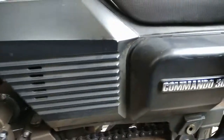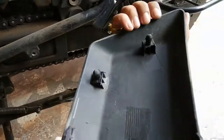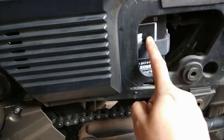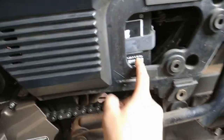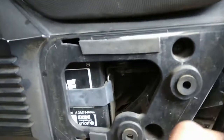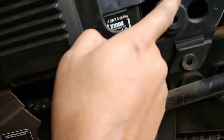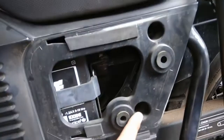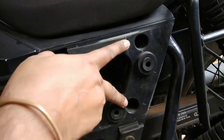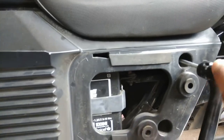Put a little pressure from the right and pull it out from one side — and it just comes out, just like that. Then the last part: you can already see the battery inside. That part is held by two screws. Use your star screwdriver to take those two screws out.